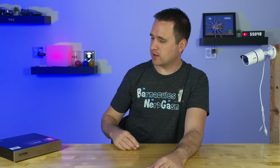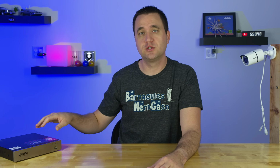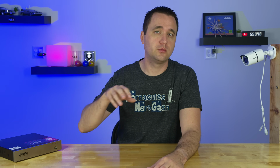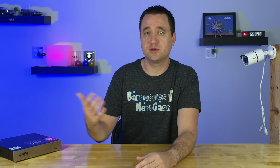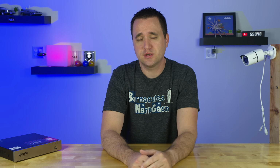But anyways, let's back up. This thing's easy to get on a tangent with. So I was using the Western Digital Blue. Everything was slow. It was slow to load. So that's why I ended up switching it out to a Western Digital Purple drive. I have one of those. It is kind of an old drive, which is why I used the Western Digital Blue drive first, but it's still a good drive. Slap that sucker in here, full 3.5 inch, hoping maybe I was running into some issues with the hard drive, and still had the same issue. So definitely not a hard drive issue.